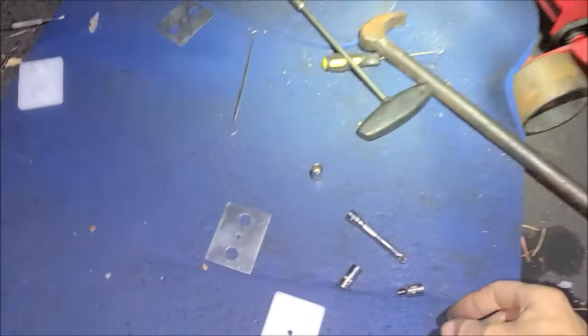I'm just going to hold this wrench, make a lot of noise, tighten up this nut by turning it clockwise, looking from underneath. And that'll jam it in position, and we'll have this adjustment locked in. Don't have to worry about it moving on us.